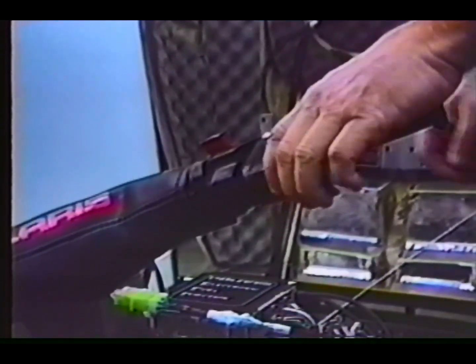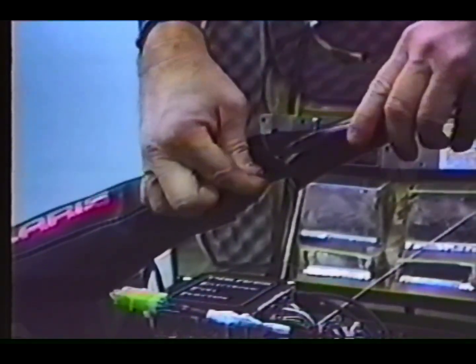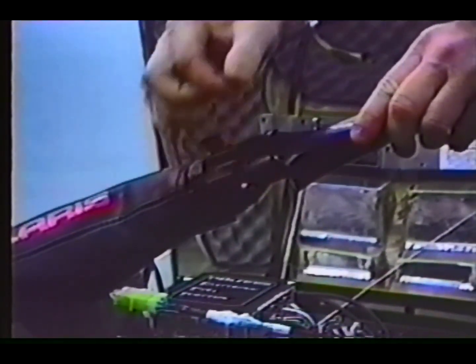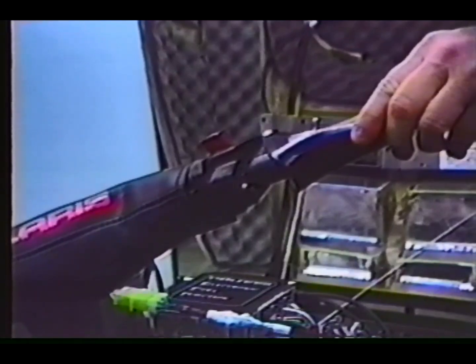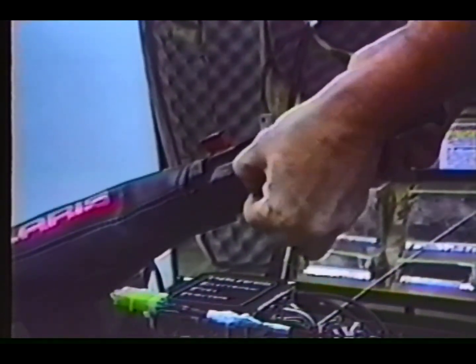The throttle position sensor is adjusted only when the butterfly is completely closed. To ensure the butterfly is closed, proceed as follows. Back out the idle stop screw. It may have to be turned 4 to 6 revolutions. Remove the throttle cable from the throttle flipper and snap the throttle cable a few times to ensure the butterflies are completely closed.